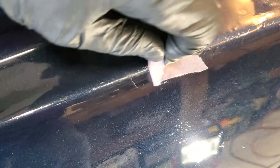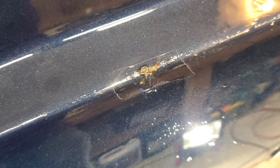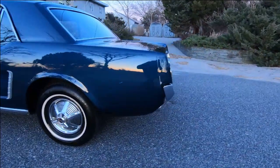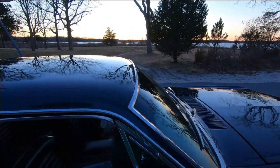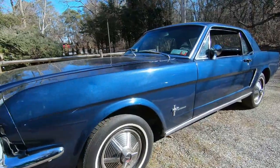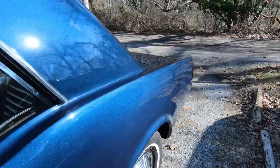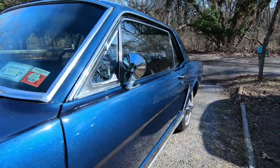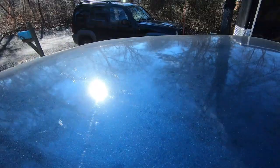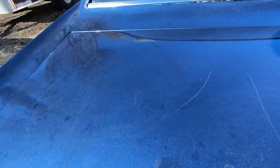Here I put masking tape over a small rust spot, and after polishing the whole car I put the polisher on really low and went over that spot — that way I'm not trying to rip a chip of paint off. The gloss on this car came out absolutely phenomenal. It had so much reflectivity when I was done, it was such a joy to look at. In the sun before, you can see some of those swirls and scratches, and after you can see the extra gloss this paint has now — even in broad sunlight there were no swirls, really a nice finish on that roof.